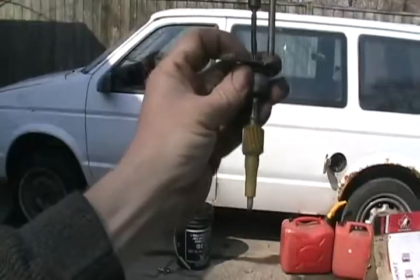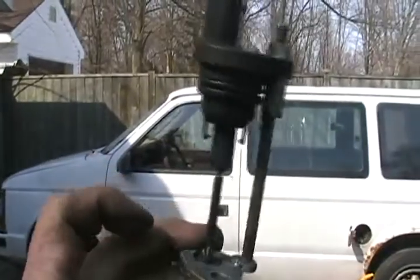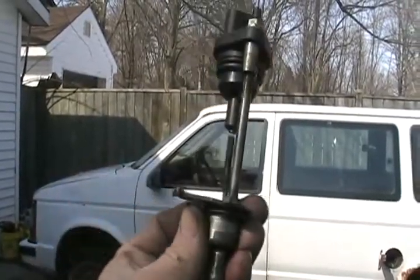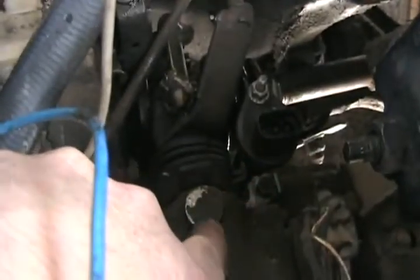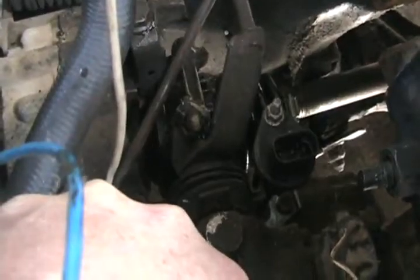Sweet. So there it is. Just a bolt welded as a stock to the little hold down plate and a nut that fastens it. And it's all rigid. Doesn't have to be perfectly aligned because the rubber acts as a perfect flex joint. Now ready to install and go test it and see if there's speedometer error. So, there it is. It's all mounted. Clears my shifter mechanism when it's fully engaged in that direction. Now just plug the wire in and test it out.